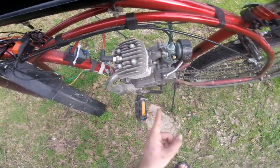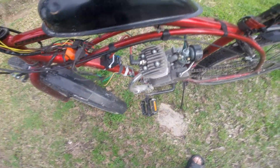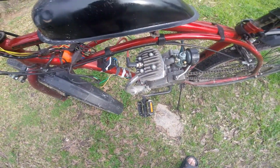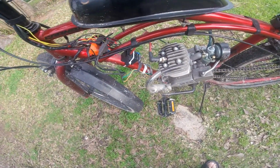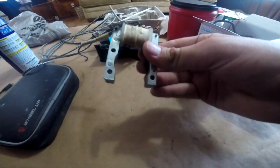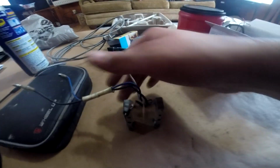There's got to be a magneto that we can put in this bike which can supply some amperage, but essentially anything kills the motor. If you suspected that these magnetos could not supply any additional voltage, congratulations, you were right. Honestly, I expected they could supply something, but quite literally anything added to the circuit is causing the motor to die. Up until this point during the testing phase, I had been using the aftermarket magneto I purchased off of Amazon because it claimed to be high performance 12 volts.